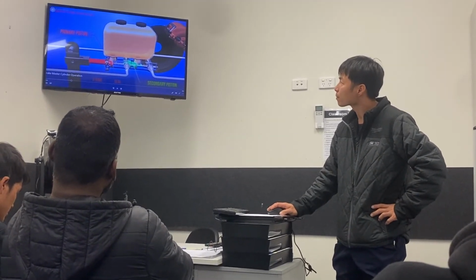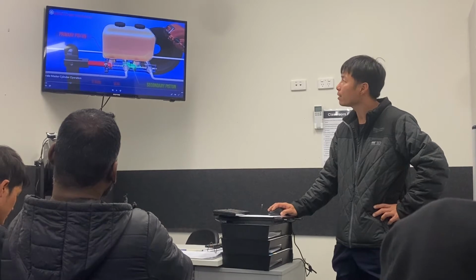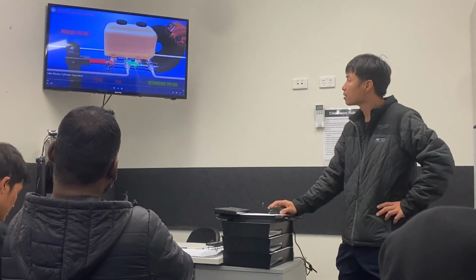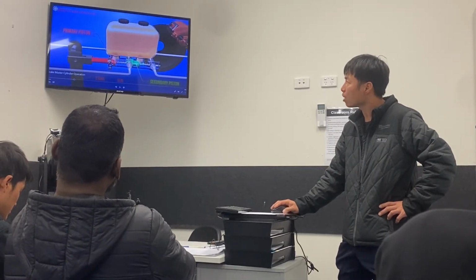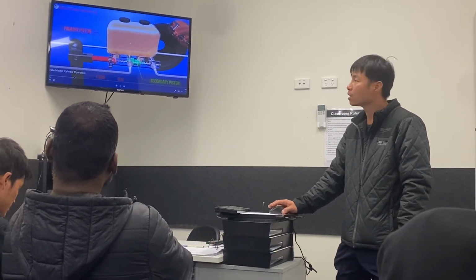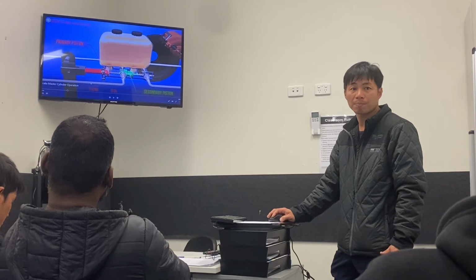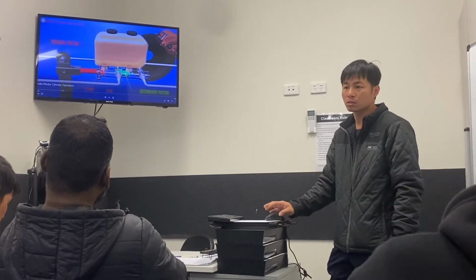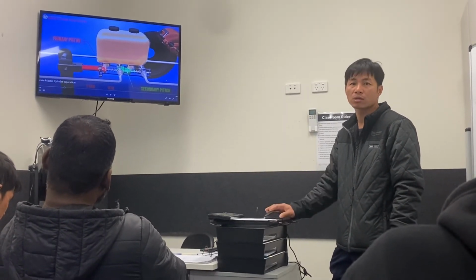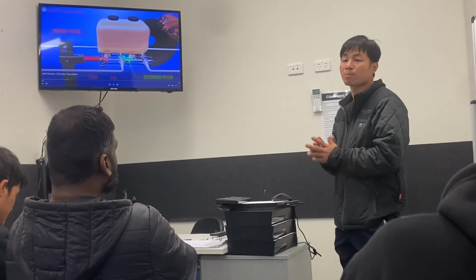And then this is a master cylinder. This is what we call the primary chamber. This is the secondary one. In this type, the primary is our inlet. All our inlet is from here, actually all from the reservoir. Alright? And the primary one goes to this pipe and this pipe, two different wheels. And the secondary drives another two pipes, another two wheels. That is how it's designed. That is why it's split into two. That's why we call it split.